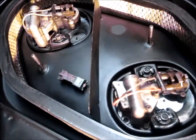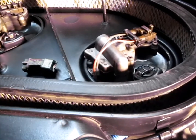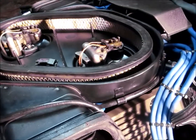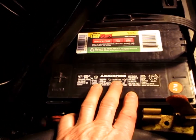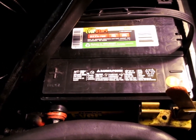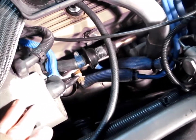you're just checking resistance in the coils and the solenoids, so that's a good place to start if you have problems. One of the things about the 1984 Corvette is the entire fuel delivery system is electrical, so it's really important. I try to keep the battery charge at 12.6 volts.